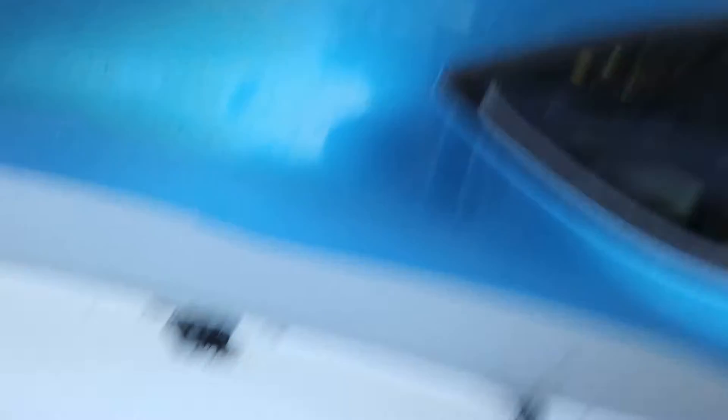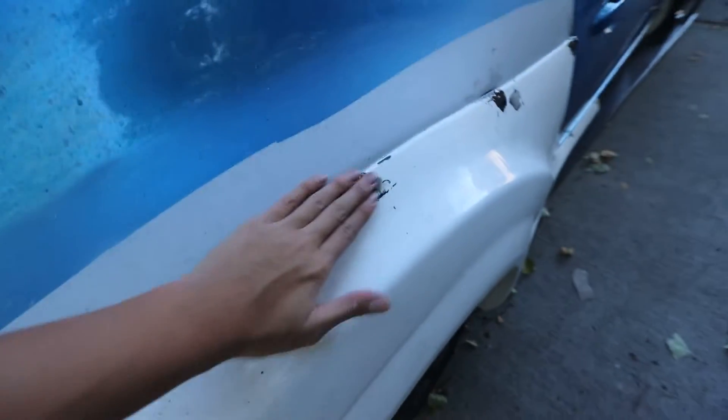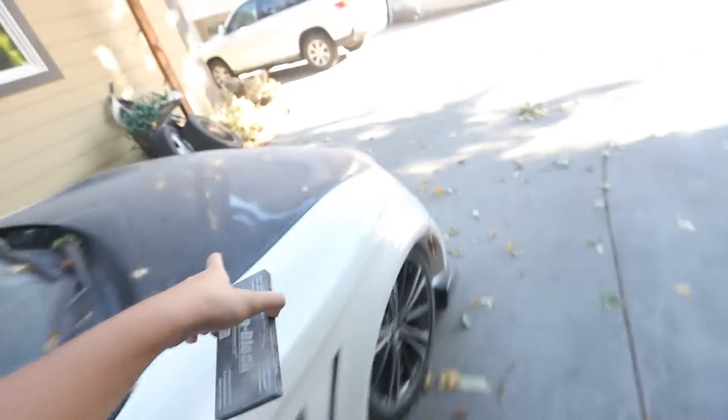It is now two days later and the panel bond is completely cured and rock solid. Listen to that — that's not going anywhere. So now we can finally start sanding the kit and making it seamless. We're going to sand this completely flat and smooth so we can go ahead and apply body filler. To sand that, we're going to be using a sanding block, starting out with 80 grit sandpaper.